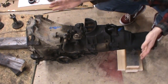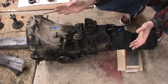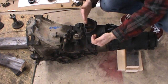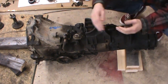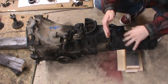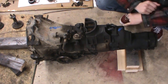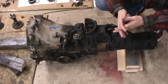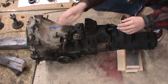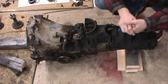Here is the standard 016 transmission. They change a little bit throughout the several iterations that Audi made, but for the most part they're all generally the same. You can tell it's an 016 pretty quickly because it has three distinct components: number one, the bell housing up front which also holds the differential; in the middle, the gear carrier assembly; and in the back, the housing that holds the center differential block. The bell housing for all of them, as far as I know, mates up to the 2.2 block — my 4000 is running a JT block and both bell housings are almost completely identical.